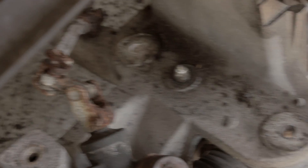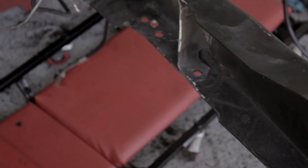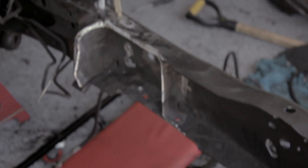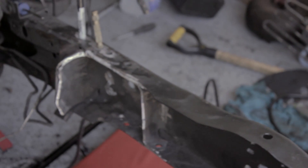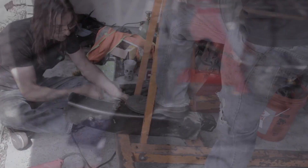These alignment pins right here on the Crown Vic front end now have holes drilled right here between the two existing holes, so that we can fill in the other holes, put those pins up. Whenever those alignment pins are in, the Crown Vic front end will bolt in and we can put the top main bracket bolts in. They'll automatically be lined up because the alignment pins were measured correctly.